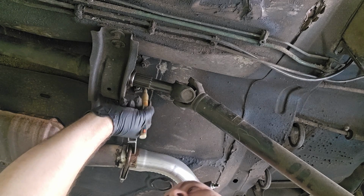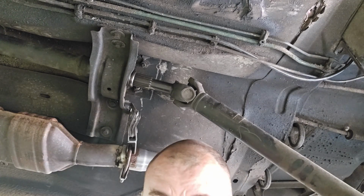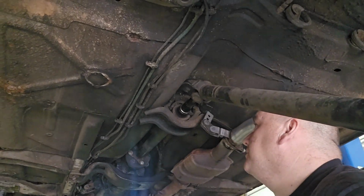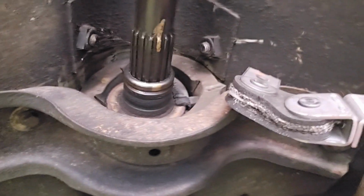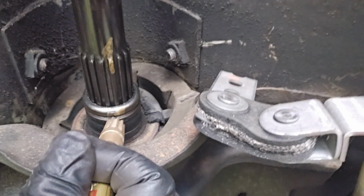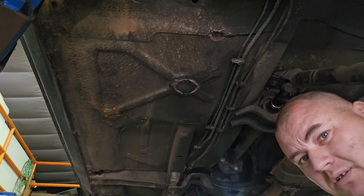because the thing is, when the shaft was made, they balanced them together. So they're in perfect balance in the order they're in. If I move the shaft so this weight is in a different position, it could go out of balance and vibrate pretty badly. And we don't want that. So what I do, here, if I can get you in here, I'm trying to see what you see. There we are. I make a mark on the tooth, and I made a mark right here on the front shaft. So I can see and realign it when I'm done. Just a good thing to practice.